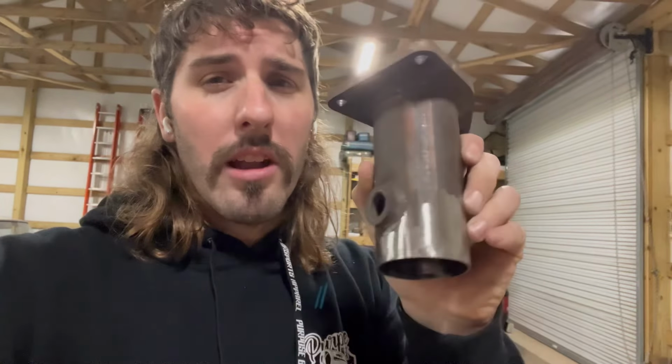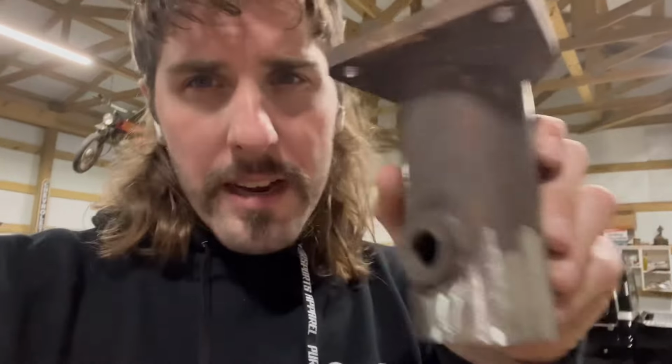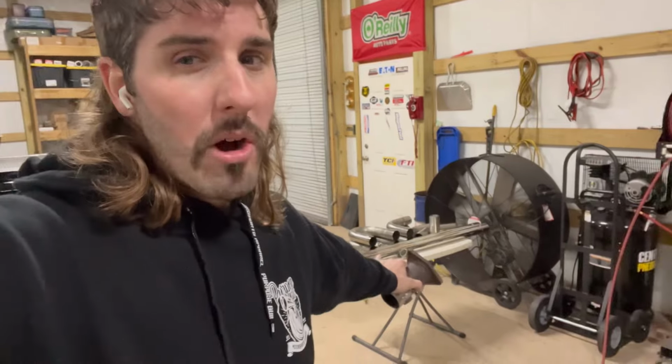First things first. I got this factory piece cleaned up, belt sanded perfectly flat. I got to go install this on a driver's muffler right quick. And this is going to be our starting point that attaches to the passenger side turbo manifold. So let me get this on. And I know this looks rusty, y'all, but factory uses 409 stainless, which a magnet sticks to, and it rusts a little bit. But everything I'm going with is 304 stainless.